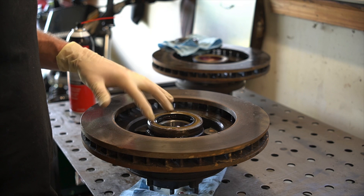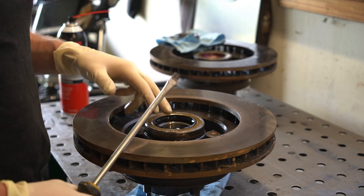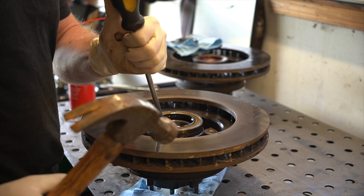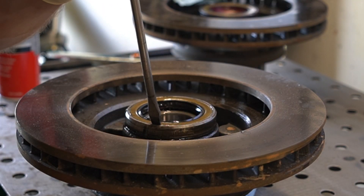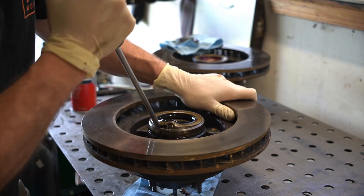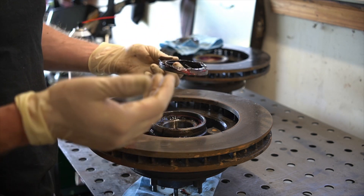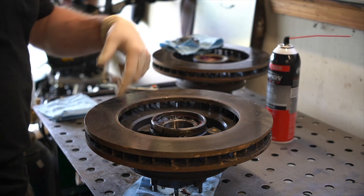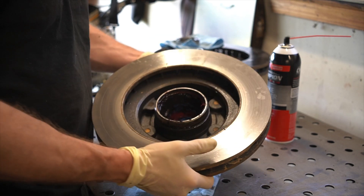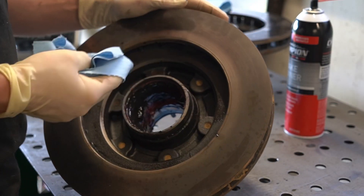First, get this thing sitting on a tote — the rotor will help suspend it — and take some brake clean to clean out this hole inside the barrel as best as we can. Now we're going to pull this back seal. If you're replacing the bearings, you can take a punch and hit it from the opposite side to push the seal out without damaging it. But these are good new bearings, and I already have new seals from the kit, so I'm going to sacrifice these seals. Just take a screwdriver, get on that edge, pry up, and the seal pops out. Obviously that method completely destroys the seal, but if you've got a new kit they'll supply you with new ones. Now we'll remove our inner bearing and wipe out all that diff fluid and grease mixture from the inside of the hub.